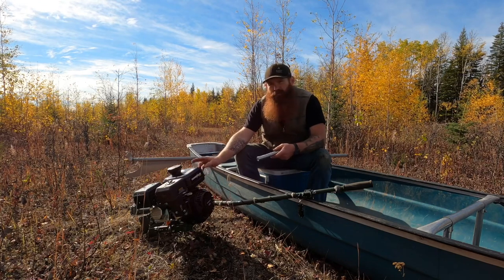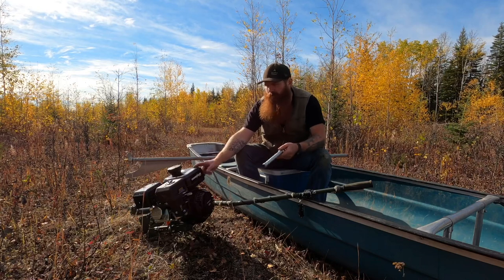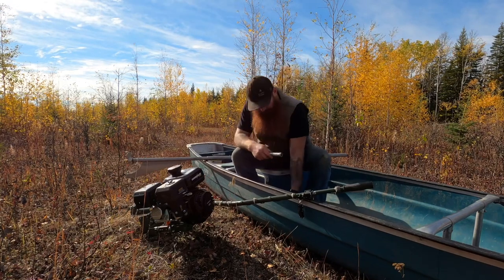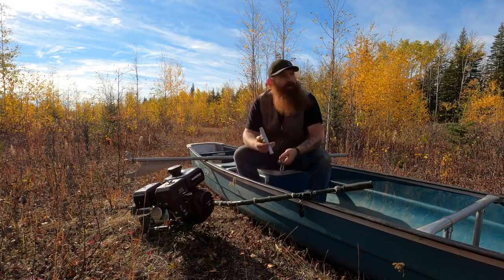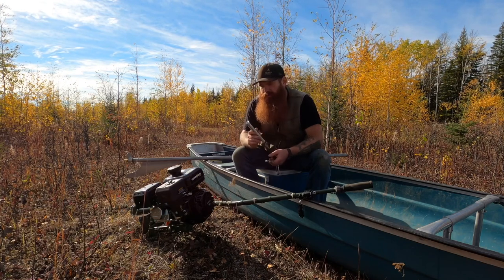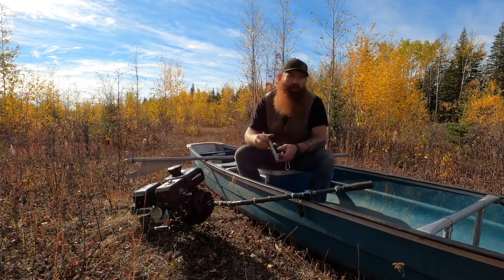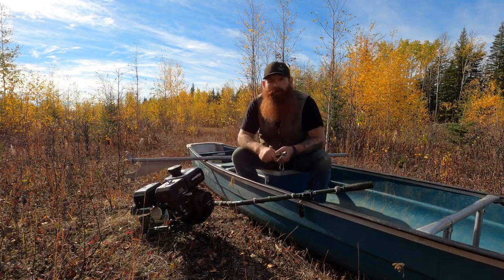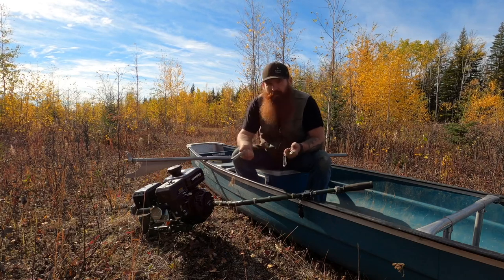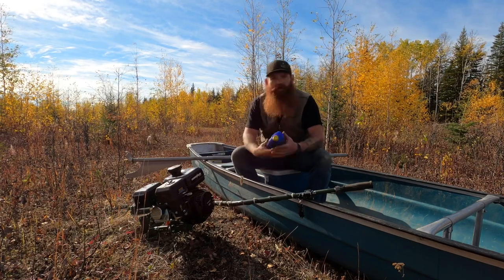This comes with a PowerEase motor — I believe he gets them from AIH. You can put a Honda motor on here or whatever kind of motor you want; he'll put on whatever you choose. The tool kit comes with a spark plug wrench that gets way down in there so you can take the spark plug out and pump all the water out if you sink it. Without this it's going to be a pain to get everything apart, because it'll be hydro-locked.